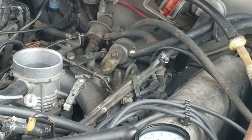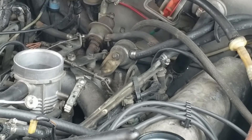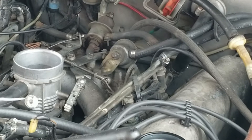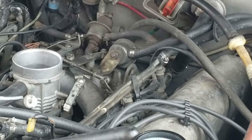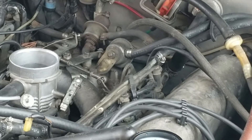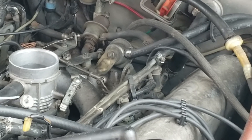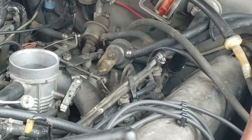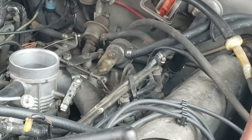I'll just lock the nut in place and try to correct all those ignition problems, because as you can see the engine is shaking. But the fuel pressure adjustment is so simple — if you can change your oil, you can definitely set your fuel pressure. Just get yourself a gauge, 20 to 30 bucks, plug it in place of the cold start valve, and you can set the proper pressure yourself or at least test it. That's about it for now — it's Sunday, so I'll do more testing tomorrow. Another video coming up tomorrow, thank you and have a great Sunday.